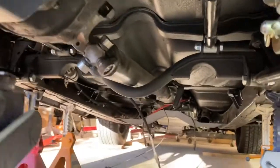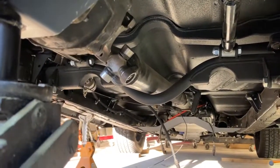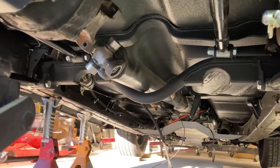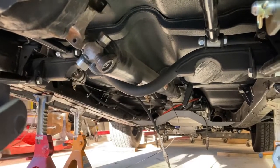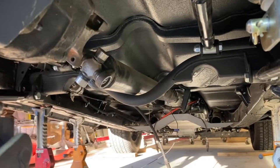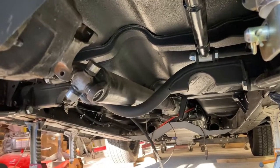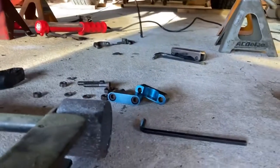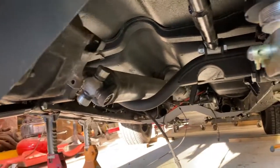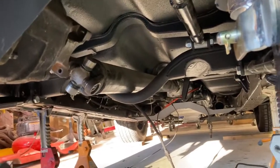The driveshaft length was fine, but the U-joints — the back of it's going to have to get cut off because the U-joints on that 12-bolt were smaller than what's needed on this Ford nine-inch. The 12-bolt rear end had a 1310 series, and the Ford nine-inch requires a 1350 series. So I've got to take that out in just a minute and take it over to the driveshaft shop.